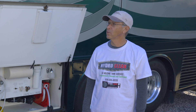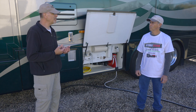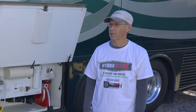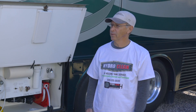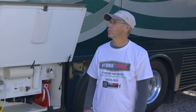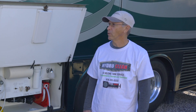That's actually the call I get the most — sensor issues. Struvite is a mineral, it's a crystal that actually starts to layer up and is left behind inside the holding tanks. It'll actually sheet up and coat the inside of the tanks, affecting the sensors. Even water treatment plants have to deal with struvite on a regular basis — it's one of the biggest enemies they're dealing with full-time.